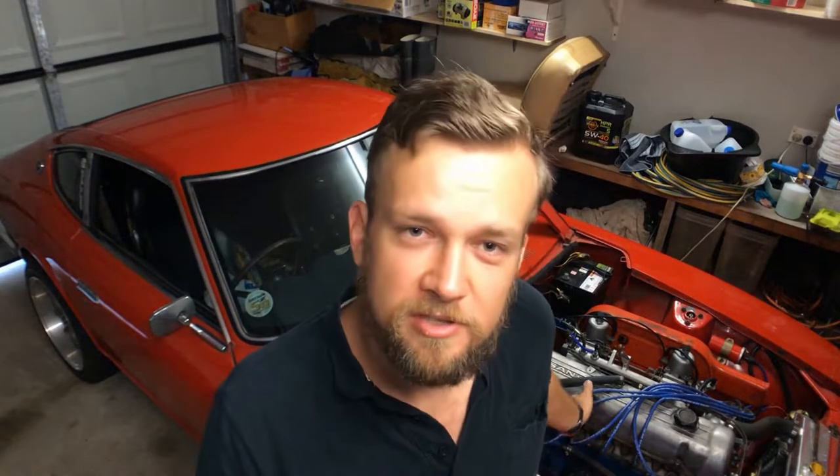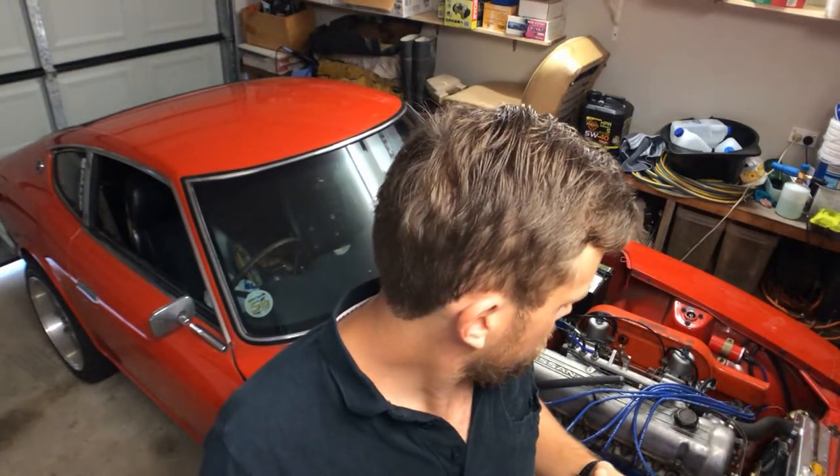I think the Knockbox is one — it's a fairly flash, robust-looking unit. I'll be using this for detecting detonation, but that's not its only use. You could use it for hearing any other engine noises: rod knock, tappets. Because the microphone will be movable, you'd probably be able to move it up and down the engine to hear which rocker might be loose and needs lash adjustment. Most knock sensors are tuned to a specific waveform, and I'm unsure if they'll actually detect signs of detonation at low load, particularly around the cruise map where I think I'll primarily use this device.